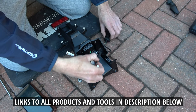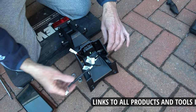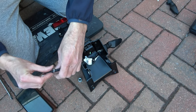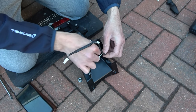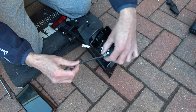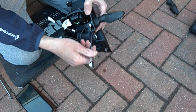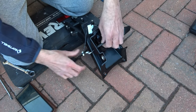Now feed the wire of your indicator through the hole in the new plate holder. The indicator has a plastic molding that slots into place. The spacer we took off the old plate holder doesn't actually fit through the hole on the new one, however I'm going to reuse it anyway. So put in the spacer, followed by the locking washer, then the nut and tighten up. Then use the 13mm spanner to finish it off, and do exactly the same to the other side.